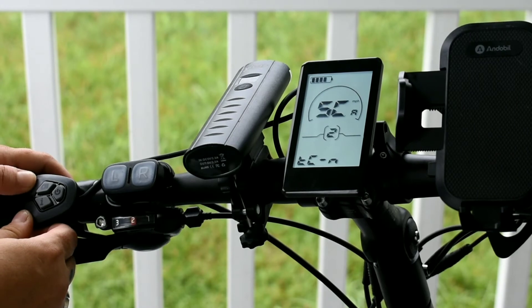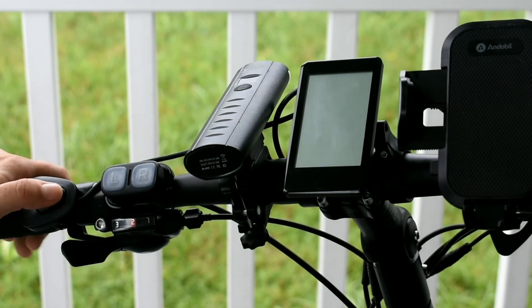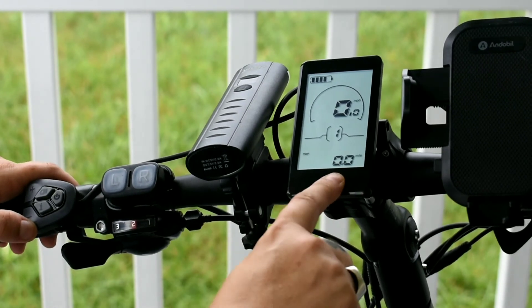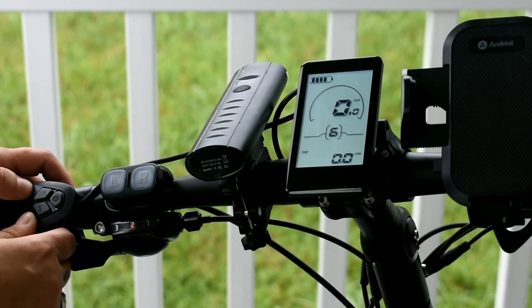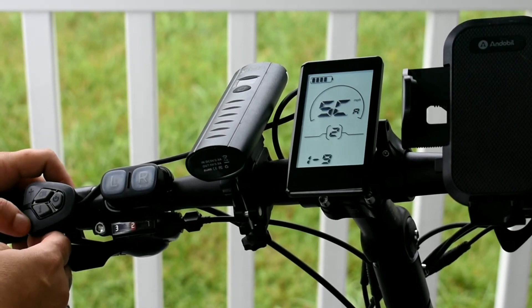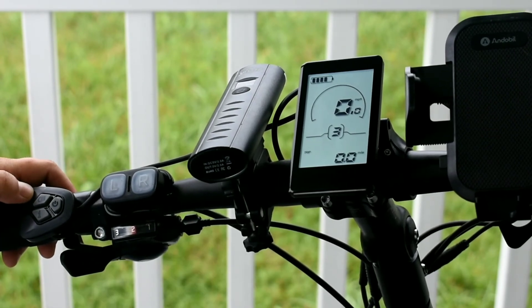When I come out of here I'll show you again — there we go, now I've got it changed to zero to nine. We're going to turn it off and turn it back on — turning it off and on is the only way I've found to get out of there. Now the trip odometer is set to zero. Let me make sure I committed to the changes... down, info. Okay, now we'll try it again — yes, there we go. Zero, one, two, three, four, five, six, seven, eight, nine — nine levels of electric assist.